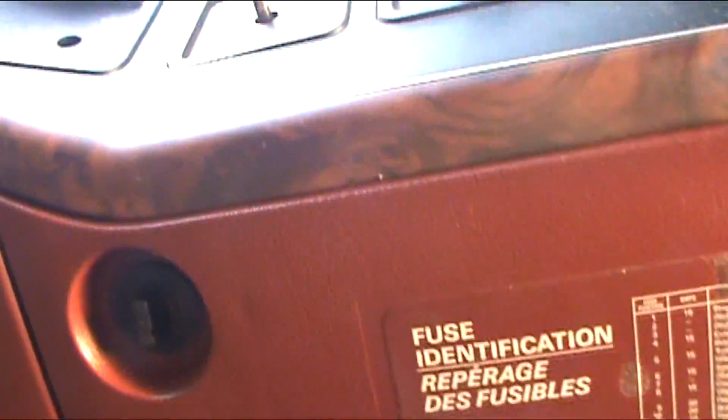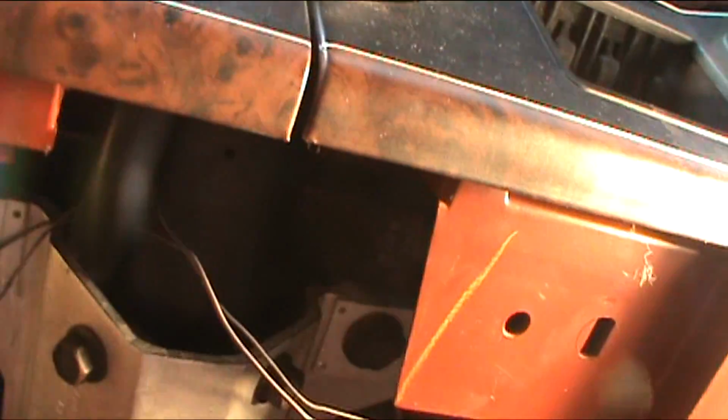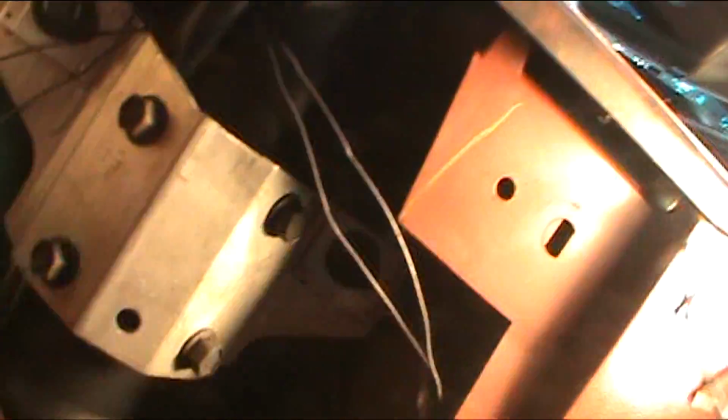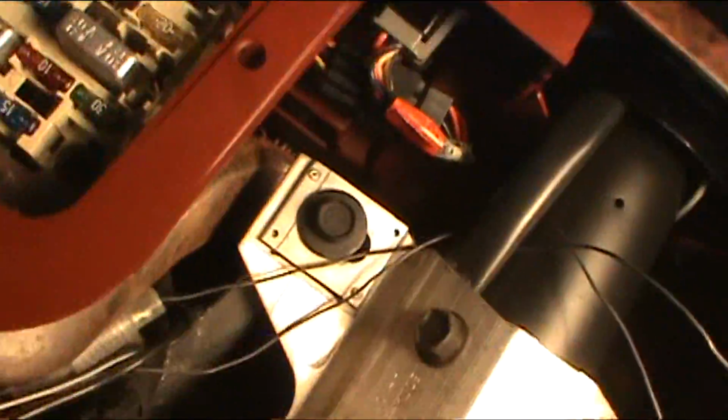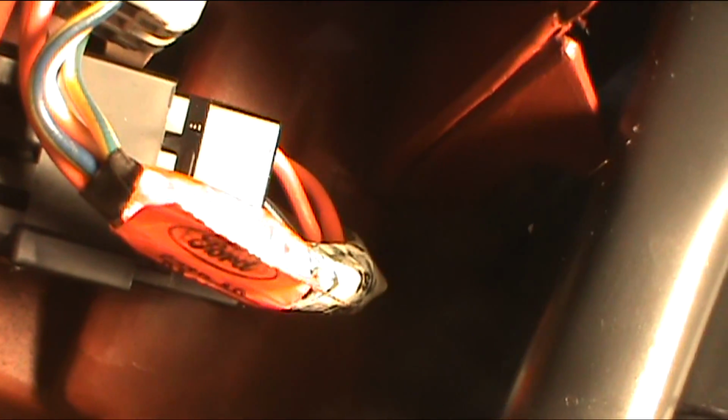What we have here is your standard panel that you're going to find on the bottom of a lot of the older trucks. Turn the screws, the panel drops out. Now, a lot of the old trucks, you used to be able to reach up underneath here and reach your arm up there and change the cluster. But as you can see, they didn't make any room up there for this. So what you got to do, Jeff, is not going to be fun. Let me show you how you do it.